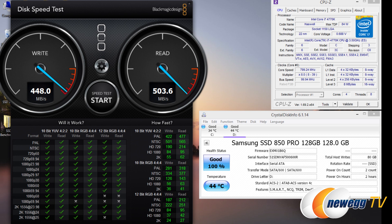This is the Blackmagic Disk Speed Test, which runs a quick test to determine how well the drive might work in various video editing configurations — testing sequential read and write performance across different video resolutions and color depths. We had about 503 megabytes per second on the read and just shy of 450 on the writes. We can see green check boxes in just about every single category, except for some of the higher frame rate 1080p higher color depth tests, which is really only for high-end video editing. For most folks doing video editing at home at 1080p, 30 frames per second, you're going to be just fine.